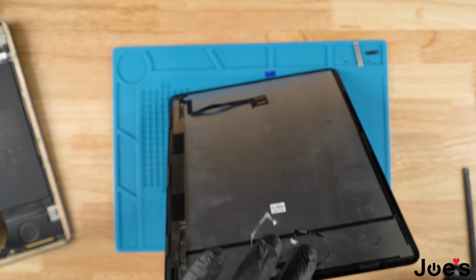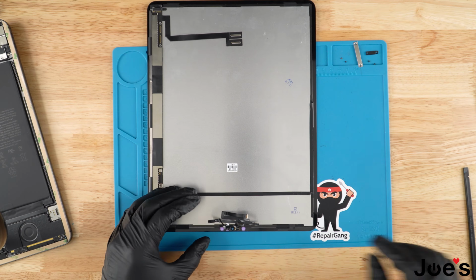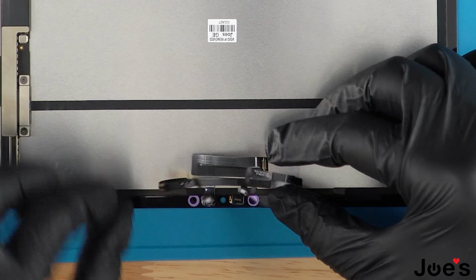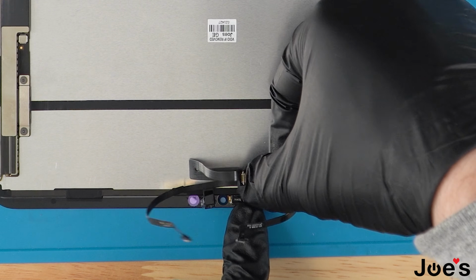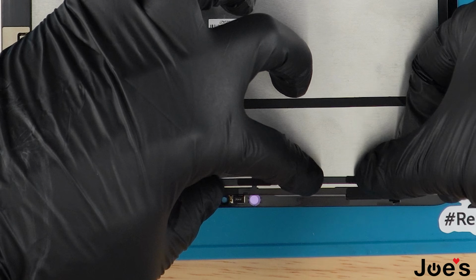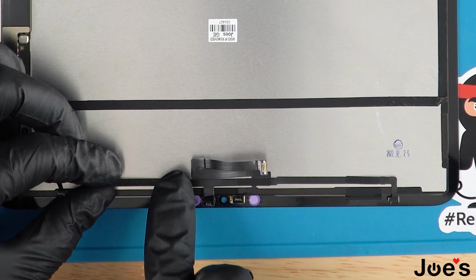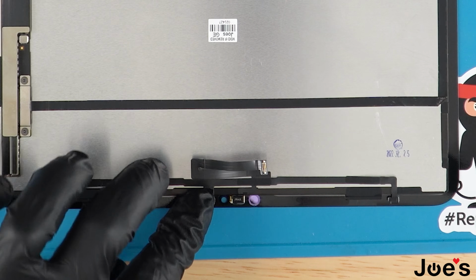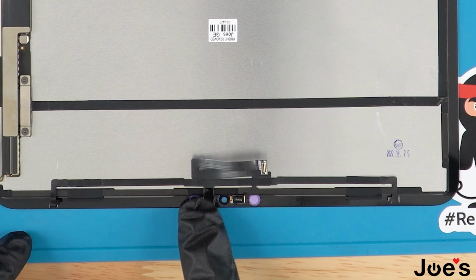The front mic has adhesive on it. Even if you pull it from the original screen, it's still going to have that adhesive on it, so it should stick. Once you do that, look at it, straighten it out a little bit, and if you stretch out the ribbon, the sensor ones, you'll notice that it falls directly on that little circle that's on the screen. Vice versa, this side as well. The Face ID camera goes down as well. It is centered.